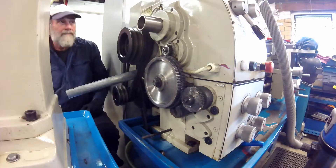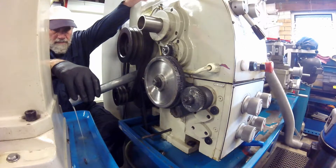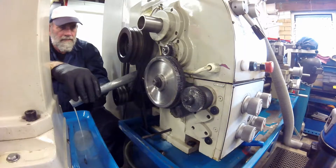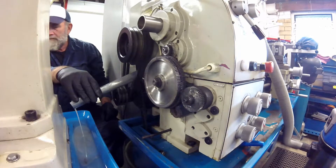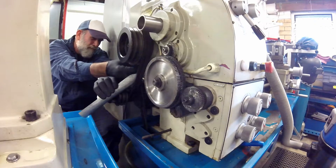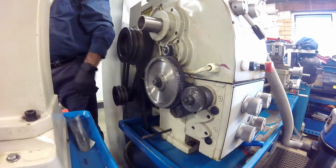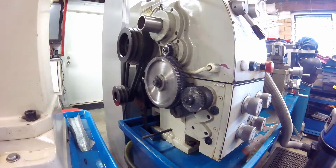When the flow in the hose stops, there's still some oil left in the sump, so I reconnect the vacuum, remove the hose plug and the hose, and this time with the drain pipe or funnel in place I turn off the vacuum and allow the remaining oil to drain. This latter process is not as clean as using the hose plug, but with only a small volume of oil remaining, cleanup is a relatively painless process. Once the oil has stopped flowing I refit the drain plug and move on to the quick change gearbox.